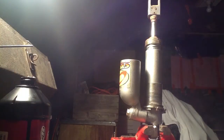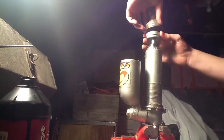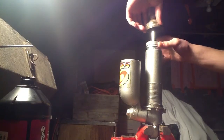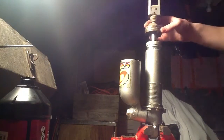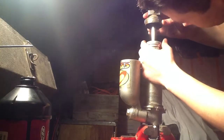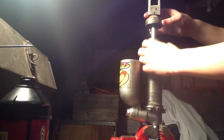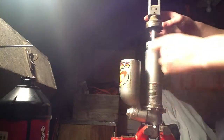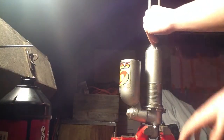What I am going to do is hammer this on top of the head seal to get it to go down. Actually, this aftermarket head seal's dust seal gets in the way of the cap, which is not good — it doesn't fit that well. So I'm going to have to hold this up and use a punch to drive the new head seal down in. I'll show you guys what I'm doing in a minute.